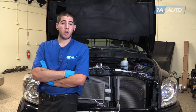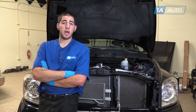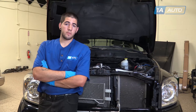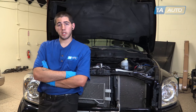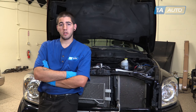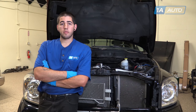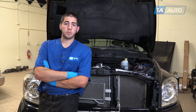After you've completed cleaning your throttle body to your liking, reconnect your airbox components and your battery. Start the vehicle. The chemicals we use to clean this, as well as the gunk that we cleaned out of the throttle body, are both combustible. This can cause the engine to run rich or overcompensate and create a high idle. It might run a little rough or a little high at first, but within a few seconds all that should even out and your motor should be running smooth again.